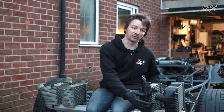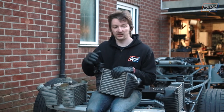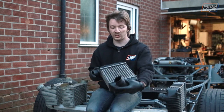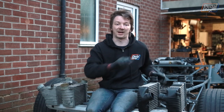Thankfully we've got a second option. About a year or so ago Adrian's A6 got smashed up and we've been able to harvest these out of it. We've done the maths - they're a little bit bigger than the ones out of the TT, which is great. The hookups on them are perfectly symmetric, which means any adapters we make for one side will also fit the other. Also the angle that the boost goes in and out of the intercoolers is a lot more compatible with our geometry at the back of the car. So we're going to make a couple of modifications back there.